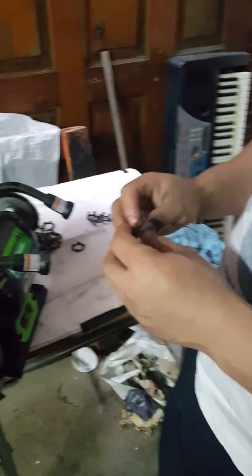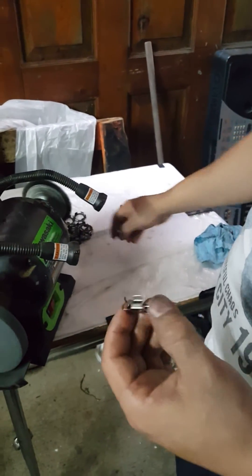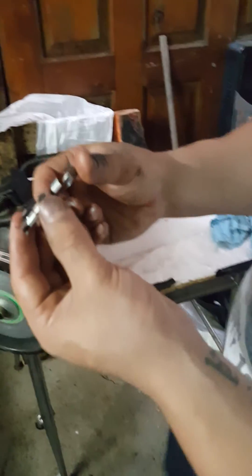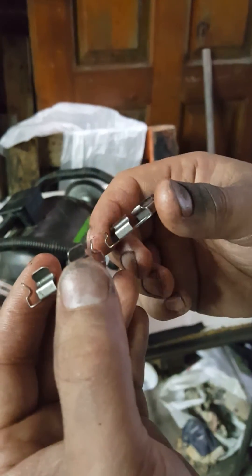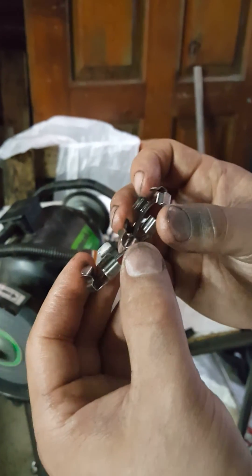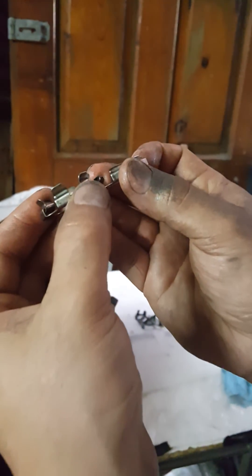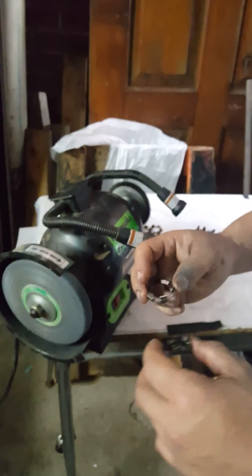My solution was to take them all off. If you want to go the cheap-man V-tech killer route, grind down all the tips — not all the way down, just to the little lobe where it grabs onto the rocker arm. That way the cam lobe does not touch it and push it down. Just grind it down and you should be fine.